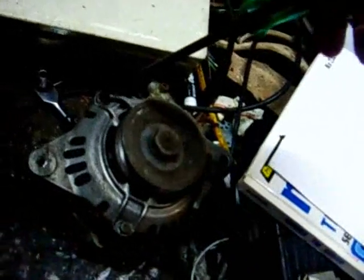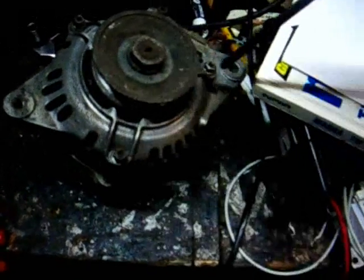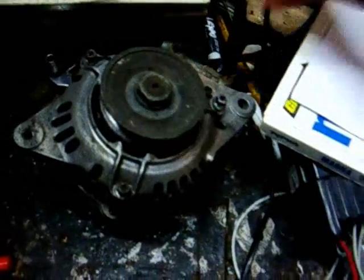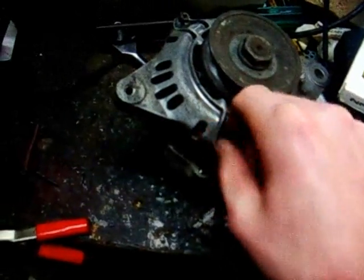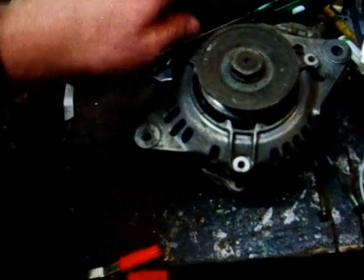If you're looking for alternators to put in your car, try and find an 85 amp Bosch. I don't have a regulator here to show you, but it's a black external regulator — not the square type, it has more rounded edges. They're pretty good alternators.